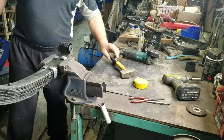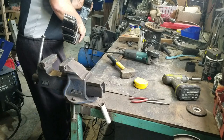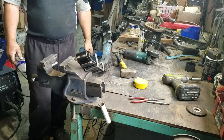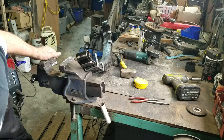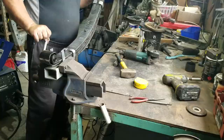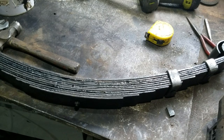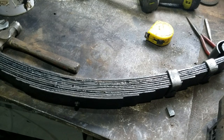That's one finished spring pack — my first ever spring refurb, and I'm very happy with it. They're a little bit pitted, but there's a few years left in them before I have to replace them. The pitting does cause them to lose their spring rate, so they will be a little softer as they get older. But they'll get through a safety check. One other thing to mention is this random loop over the main eye — that's called a military eye or military hanger. Should you break a main leaf, it will be encapsulated within this loop and you will get home.